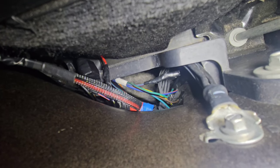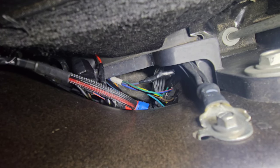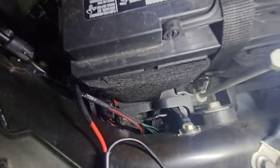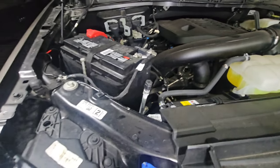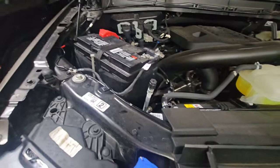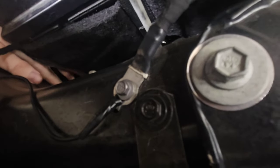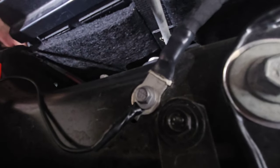One wire is taped because I thought I grabbed the right one — they don't really label them all that well. That was the one that goes to the passenger footwell and it's not live, so I had to take it off and put it on the other one. There are two sets of wires, and don't do what I did — test it with a test light first. The other set was very hidden so I just thought I had one set. Obviously if I had known there were two, I would have tested it, no question.